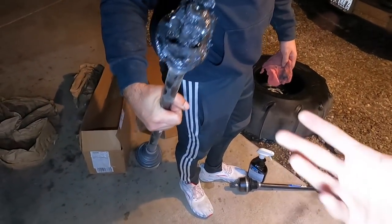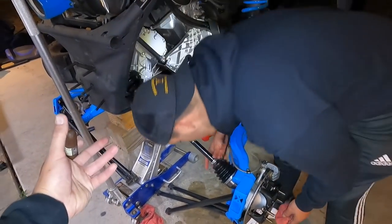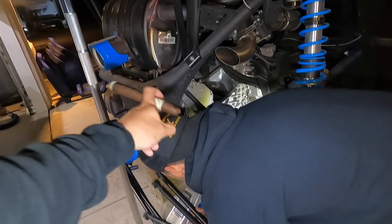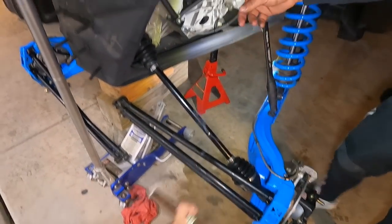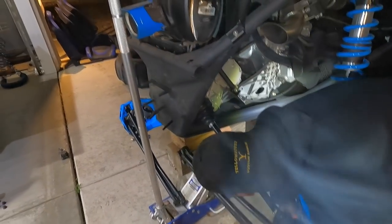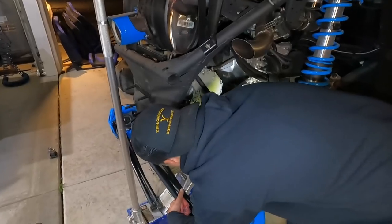You can't really compare the grease accurately because some flew out — we can't say that for sure. But the OEM one just looks so much bigger and beefier, and that is why we went back to stock. For installation, pretty much push it in there and pop it in. Grease the end of it — next time you have to change the CV it's easier to pop out. It changes things but yeah, greasing the end makes it a lot easier to pop in. Vice versa — it's that easy.